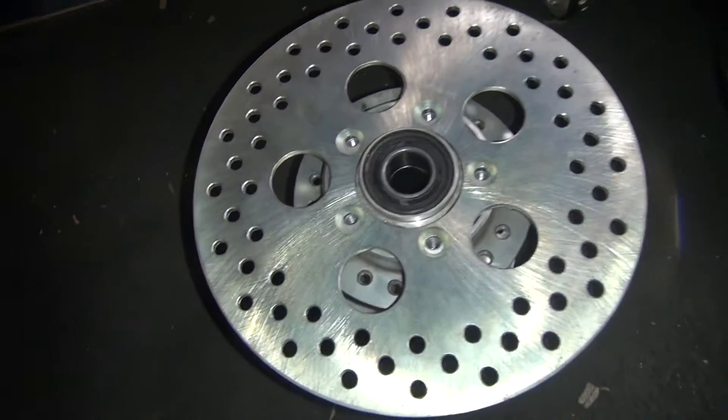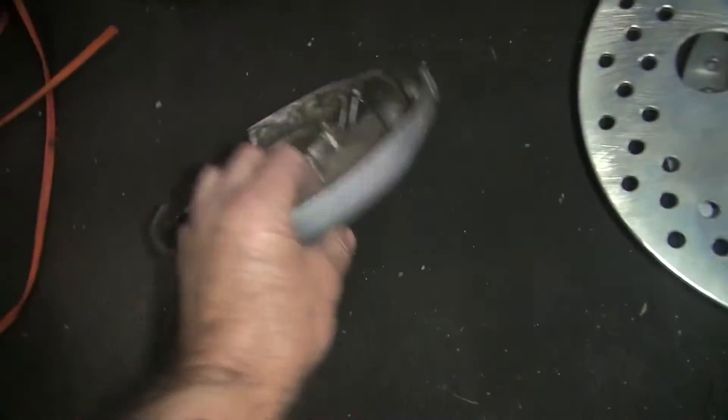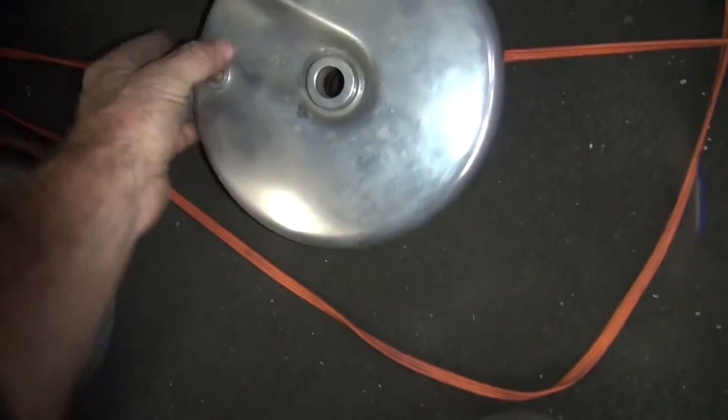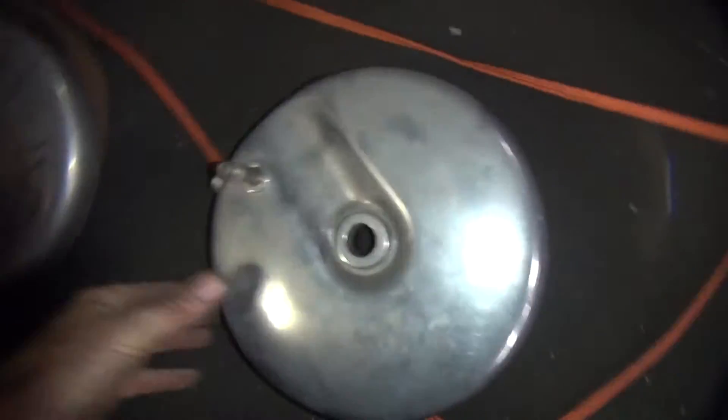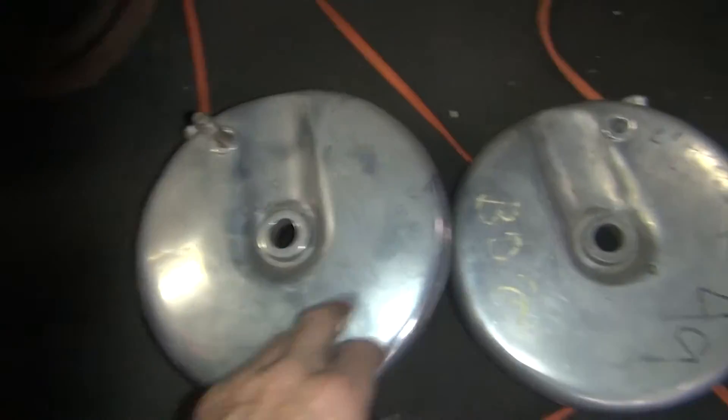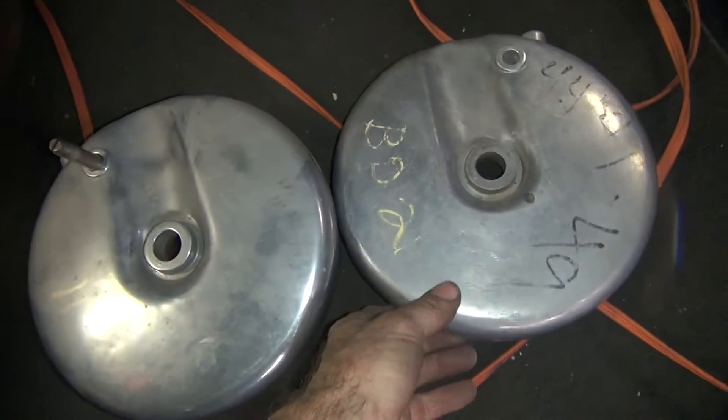To hide the fact that you have disc brakes on a drum brake bike, we have a backing plate here, which is what the brake looks like when assembled. We've got lots of parts laying around. Here's my twin brake setup — a left and a right, a mirror image of each other, so two different ears.